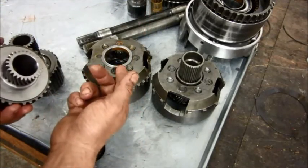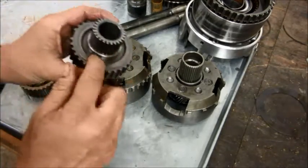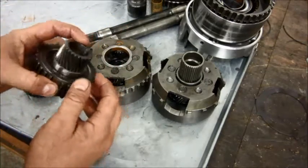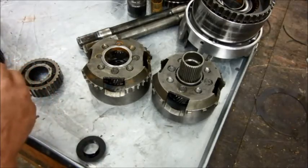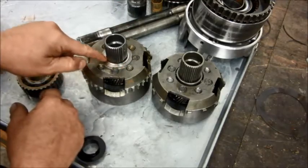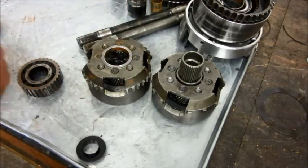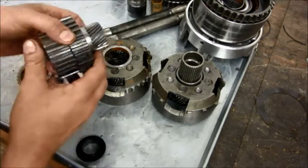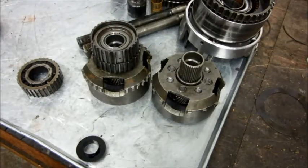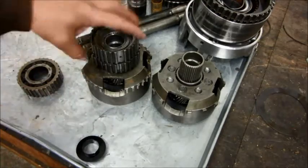This had a taller neck on it that would ride into this cutout area right here, and I had to cut that down because it was riding against the sprag. So if you put this in with just the journal, it's just barely above that, and the sprag goes right on. This bigger sprag is a key element in making this transmission do what it's going to have to do — it's such a significant improvement it's worth the time it takes.